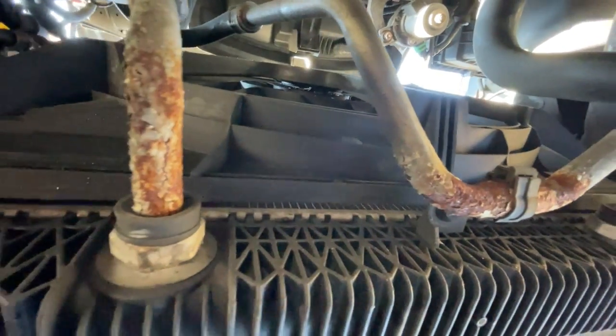I made the decision to take the chin spoiler off before the road trip so it wouldn't get ground off on rocks. Internet know-it-alls will say it'll overheat your truck. I did notice the trans temps were a little hot crossing the prairies. For reference, I tow my drift car — about 6,000 pounds on the trailer — at 110–115 km/h, with trans temps usually around 70 degrees. With all the truck camper gear at 130 km/h into a headwind, I saw trans temps close to 80, and up to 100 degrees climbing mountains. I think the degraded coolant would play a factor in that.